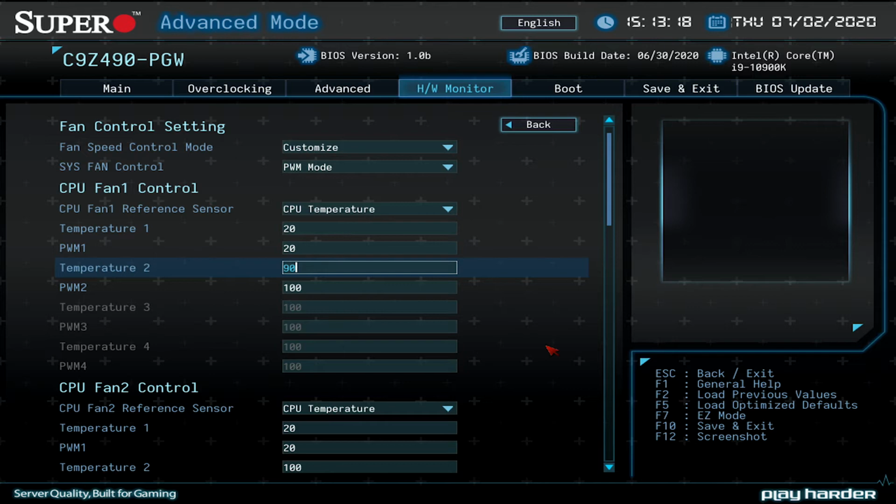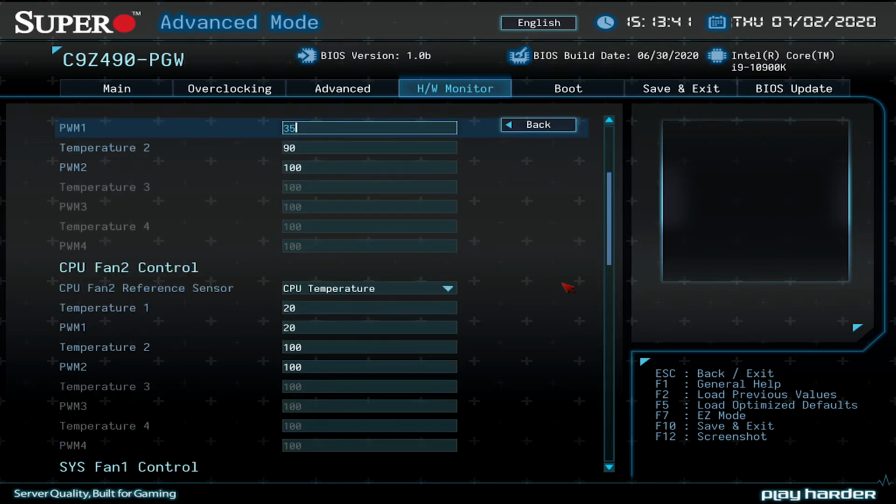And this is not something you have to do. I've actually already overclocked this board to play with it, to get familiar with it before I introduced you guys to it. Because last thing I want to do is like an unboxing video and come here and be like, yeah, I know nothing about this board, but good luck. And you know, as a matter of fact, we're going to trim this up because these fans are not loud. So I'm going to go ahead and enter 35 as our minimum fan speed, just so that we have a little more edge on our thermals while we're overclocking.